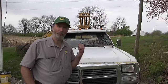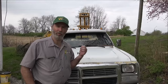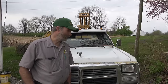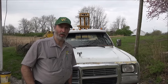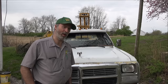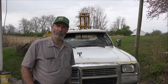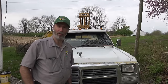This truck is a five speed. If you have an automatic, in stock form at this power level, you're going to blow through it pretty good, so you'll need to do something about a converter and probably a transmission build. The Getrag can handle that much horsepower as long as you keep fluid in it. Clutch, depending on how many miles you have on it, will be borderline at that point. A thousand foot pounds is a lot for a single disc to hold. If you plan on towing a lot, I would recommend a dual disc, or a real good single will also suffice. But you're probably here to find out how to get 400 horsepower for less than $4,000, and I'm going to provide that for you here now.